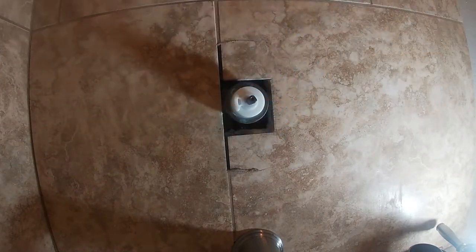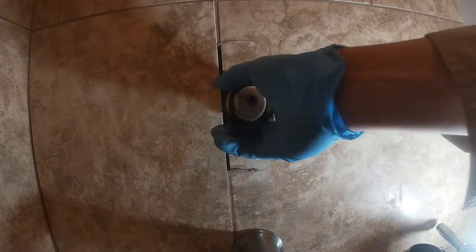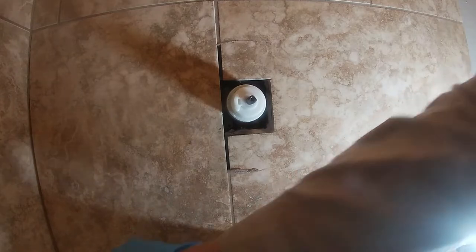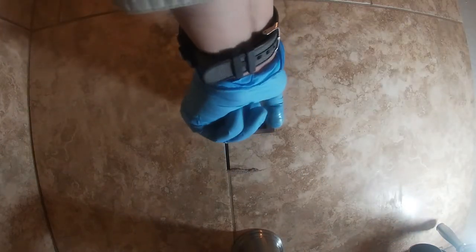If the ring does not come off like it did in the video, just keep spraying it and keep applying pressure — it's going to take a few minutes. There are some times where it's actually not going to come off. At that point, get yourself some heat. Use a heat gun and just heat the place up, and that will make it easier for the ring to come off. Thankfully I did not have to do that here.